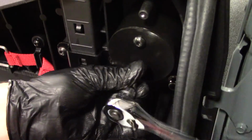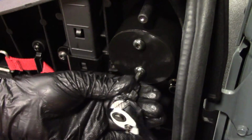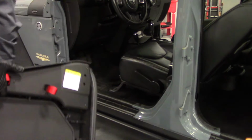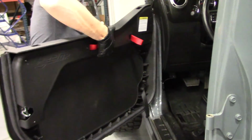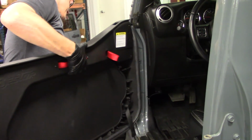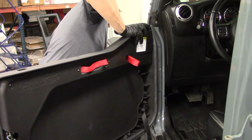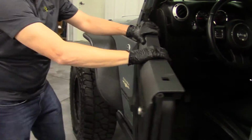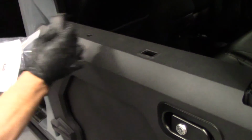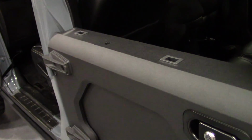All right. As far as the actual door, is there any other thing that you need to do other than basically get it out of the box and slide it into the hinges to be able to utilize it? Right. I mean, it really is that easy. It's removal of the factory door, which takes you a couple minutes, and then it's lifting this door out of the box, dropping it into the hinge pins, and then as far as the uppers go, you need to drop in stabilizing pin receivers into the lower, and then you drop this upper into the lower with the stabilizing pins in place, and you're good to go. Yeah, very simple and straightforward install.